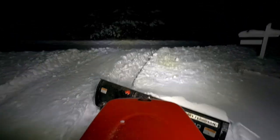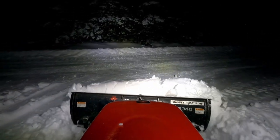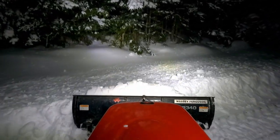That's quite a steep little hill. It doesn't show as steep as it is on video, but it is quite steep. So throttle up a little bit, put the diff lock on, go into low gear.